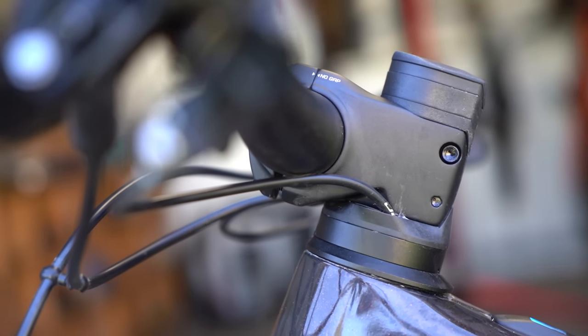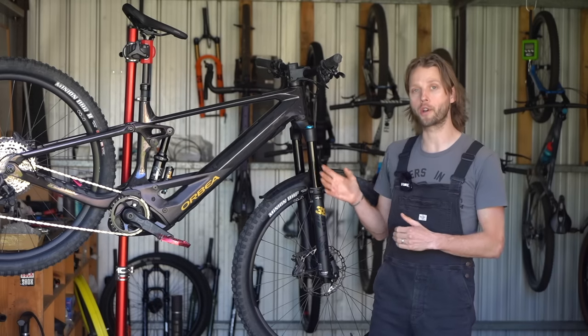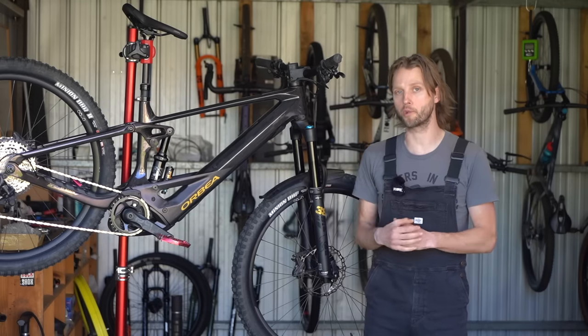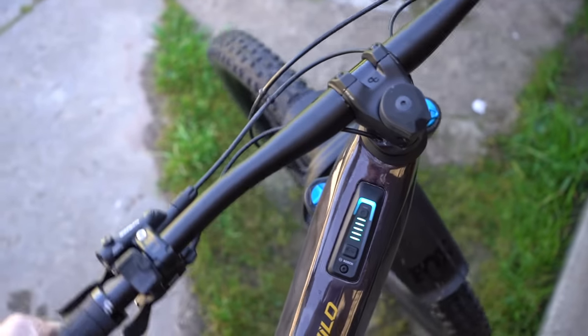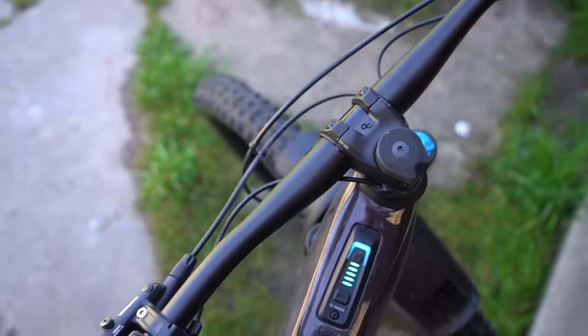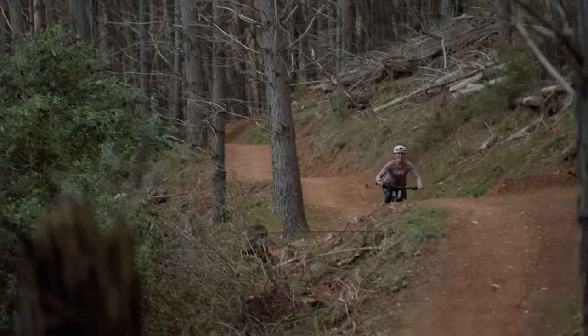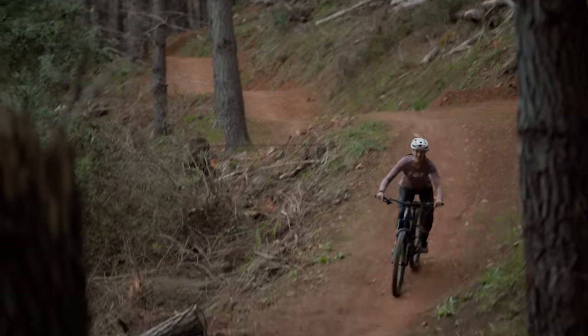The rubber seals do limit water ingress in the first place, and Orbea has specced high-end enduro cartridge bearings to improve long-term durability. We also like the hidden steering limiter, which prevents the bars from over-rotating in the event of a crash, while still being totally unnoticeable while riding. And so, although it isn't perfect, there's no doubt that the Orbea Wild is still one of the best e-bikes